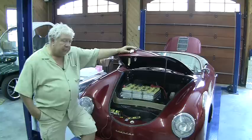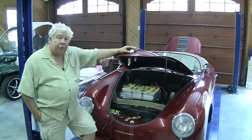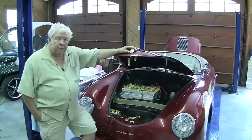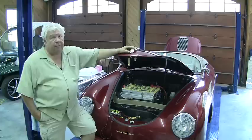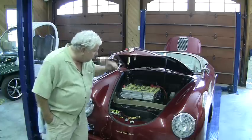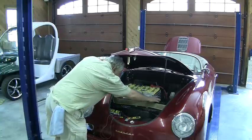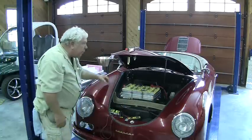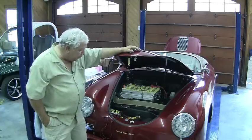Our charge voltage in our various stages: we're going to go for 130 volts on stage one of our charger, 133 on stage three, and 135 volts on stage five, and kind of hold that there and let them top off. This is some of our front battery pack, and this is our RS232 connector where we plug in a laptop to do that, and that's pretty straightforward.